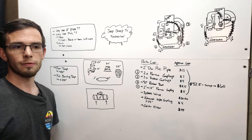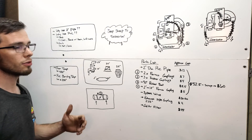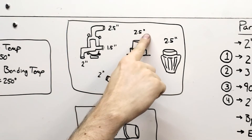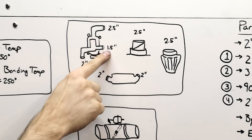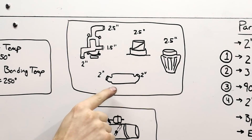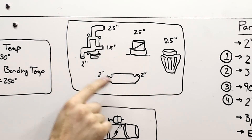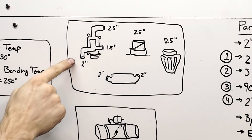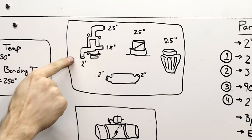Finding all the right parts is the first challenging part of every project, and it was definitely a challenge here with no kit or instruction manual. The throttle body on the Jeep is a two-and-a-half-inch diameter. The supercharger also has a two-and-a-half-inch inlet port, but the bypass is one-and-a-half inches and the outlet is two inches — all metric but these are the closest equivalents. The Mini Cooper intercooler from a previous video has two-inch ports, which I specifically selected to match the supercharger outlet.